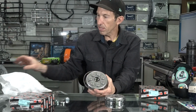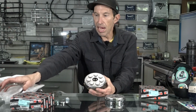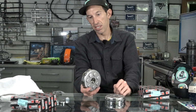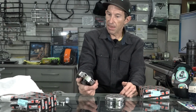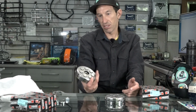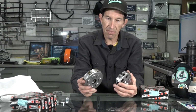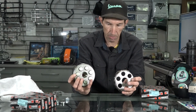The only reason you want to do this is if you have a high performance setup that revs really high, and the higher RPMs will cause these fingers to start expanding, and the clutch kind of explodes in the engine. I have seen on stock setups where they explode sometimes as well, but if they're not abused, they usually work pretty good. Heck, I've ridden a Rally 200 thousands of miles, and it still is on the original part. So pretty much that's the main difference between the 2 clutches that you find from 1959 all the way up to the 2000s. Either 7-spring or 6-spring.